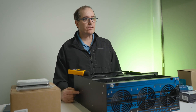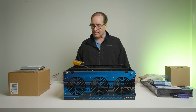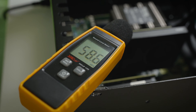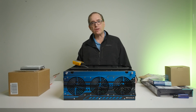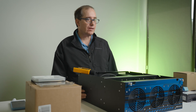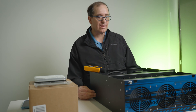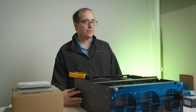That's super good news. I put the six fan speed reduction cables on and it dropped down to about 57, 58 decibels. I think those seven or eight decibels are pretty much what it takes to make this comfortable to be in a room. It is significantly less noisy. I'm going to run with that right now and not do any other modifications — no new fans, no Dynamat. I think that might be just enough to make this comfortable and livable. With that, I'm moving on to the performance upgrades.